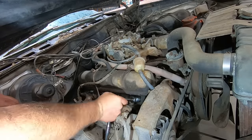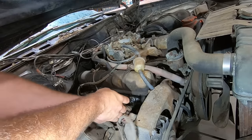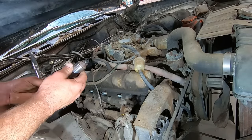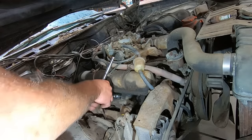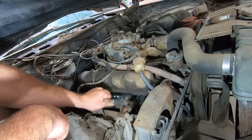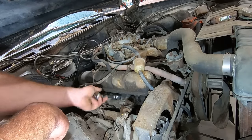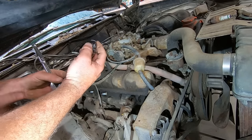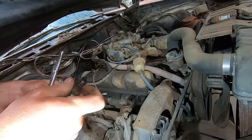Well, they're all ACs, so that's good when they match. It usually means that somebody wasn't swapping spark plugs and they weren't a cheapskate. A little sooted up, not bad though. Hopefully the rest look all the same. I feel like we had a stuck valve on that nailhead, did we not, Duff? Oh, didn't want the valve cover gaskets like silicone. Again, a little sooty, not bad.